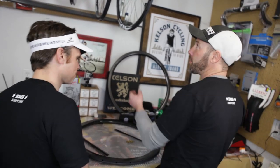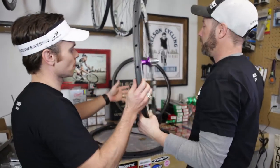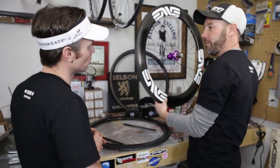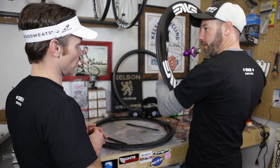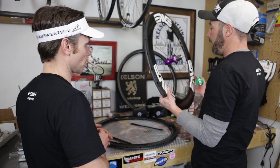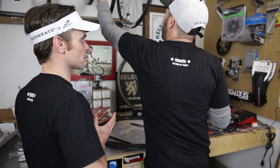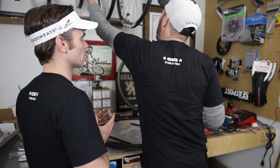A wheel also has offset. Take this wheel that we built up earlier, and if you look down it, you can see that it has offset. See that the spokes are more tensioned out this way. In order to compensate for that, White Industries has made the flange larger on one side. I'm assuming every wheel set's the same way, right? For the most part.